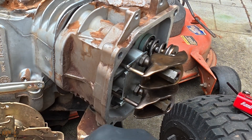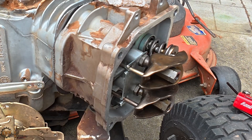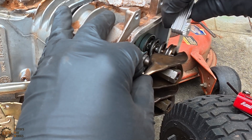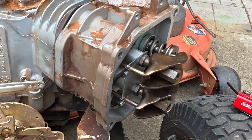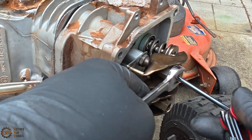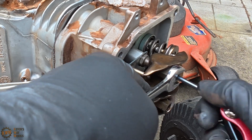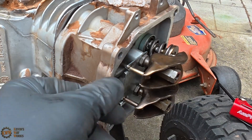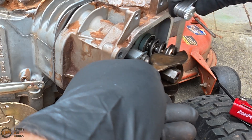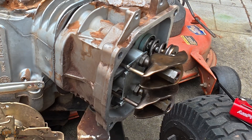Let's see what we have now. I'm going to start with the 0.004 — 0.004 is loose. Let's try our 0.005. I think we loosened it up a little too much, let's go ahead and tighten it back just a hair. It's a very fine line between too tight and too loose. I like that — I think that's good. Let's go ahead and torque that one.